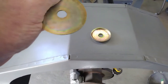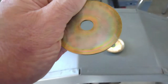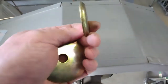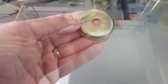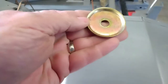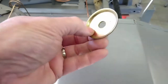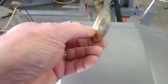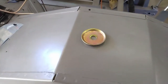In a previous video I installed the seatbelts and I mentioned that I wasn't overly impressed with the thickness of these washers. So rather than replace them I've decided to supplement them with these washers here. These are a little thicker and they have a cup in them. They're actually washers from the rear shock mount on a Ford Festiva. So these are thicker and they have this rib around them for a bit of reinforcing. This will be a lot stronger than with just that single thinner washer.